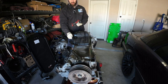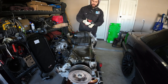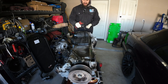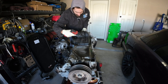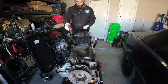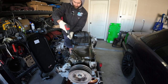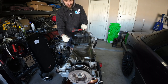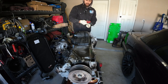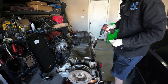These are just 10-millimeter bolts for this bottom sump. I'll probably either reform this or get another one entirely because this has definitely seen a rock or two in its day. Note to self: make sure I get skid plates when I get a new pan, because there were no skid plates on this — that's what caused this crushing portion.